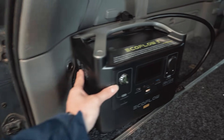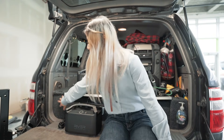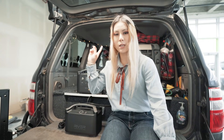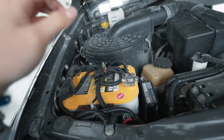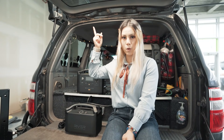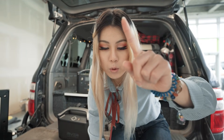Just a quick rundown of what this whole setup is: I'll have the lithium battery — one hidden in there, and then the main one with all the plugs on top — connected to my 12-volt, charging through my secondary battery, which is connected to a DC-DC controller. That will cut off power from the main battery if the secondary drains too much, so I can still start the vehicle from the cranking battery. Energy source will come from the 100-watt solar panel on my roof, and maybe in the future another 100 watts on my bonnet hood as well, plus the alternator as I am driving.